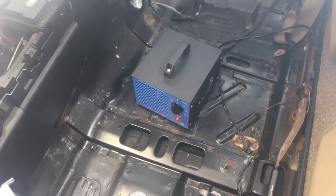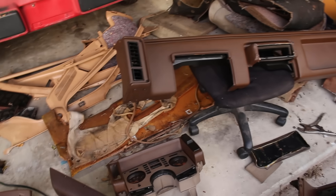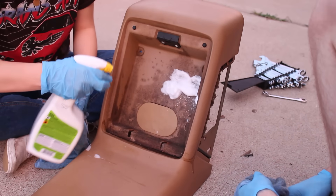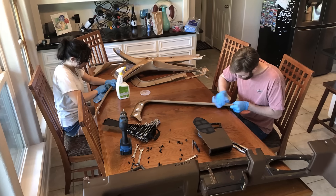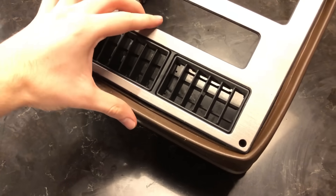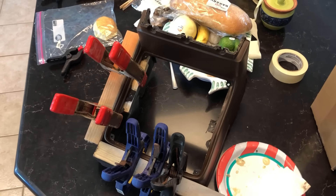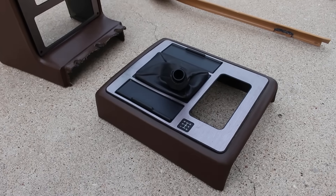With the ozone machine running in the car, it was an all-out cleaning spree on the interior panels. A lot of the panels were more or less clean with a quick rubdown and looked brand new in minutes, but there were definitely some that needed a lot more attention. While I Tom Sawyer'd my friends into doing more cleaning, I took care of a problem that plagues almost every Fiero — bowing out center console panels. This is remedied by cleaning out the original foam adhesive and using a surplus of clamps after squirting in Gorilla Glue to all the seams. After letting those sit for 24 hours, the interior panels were finally clean, fixed, and looking damn fine.